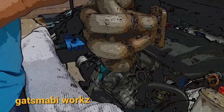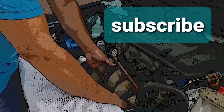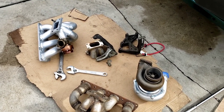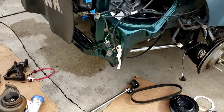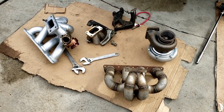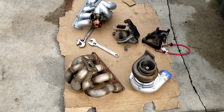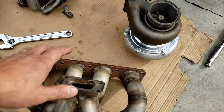This is already built — all they needed to chop this and run the number four and number one piping all the way to the flange and cut this off, so this thing will be sitting like that and then the turbo will sit on top of it. Welcome back guys, another vlog right here. I was telling you guys about the alternator relocator bracket that didn't work and the front traction bar — that's all squared away. And now I had a turbo manifold lined up here. I don't mind the weld but it worked — I'm not a welder, I'm just trying to save money, proving myself that I can do it, and I did. It works like a charm, no cracks, nothing.